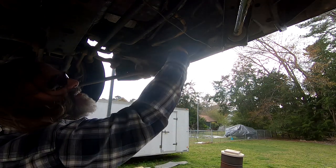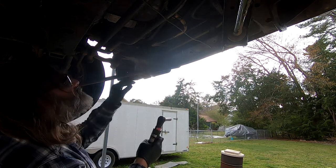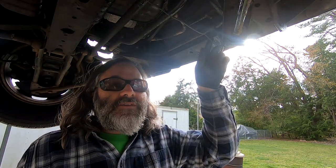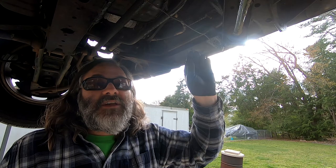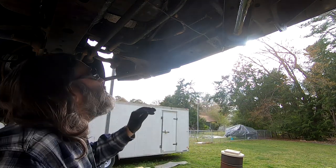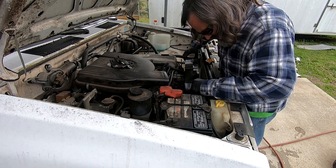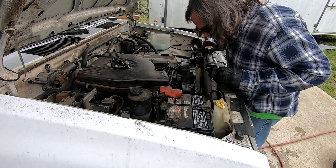Okay, we're up under the truck now. I can see both the lines right here where they go on. When you take those hoses off the transmission cooler, you want to make sure that you turn the hoses up, or put a pair of vice grips or a hose clamp on them to keep them from leaking any fluid while you're changing the radiator. All right, we've got our hoses disconnected from the transmission.